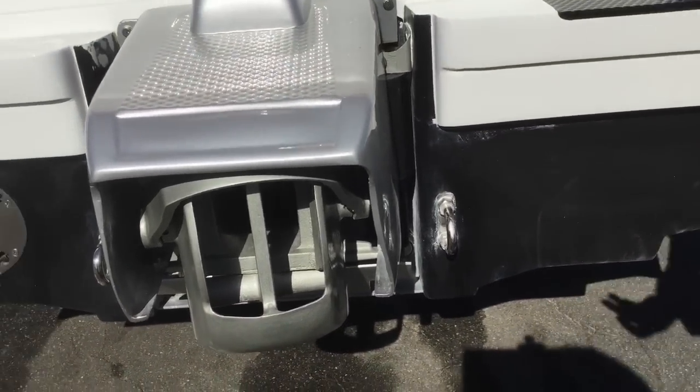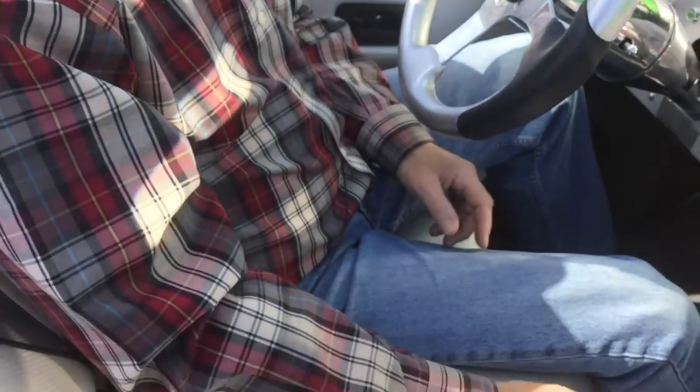So now let's get in the water car. Welcome aboard. We're about to take the water car in the water and want to show you the steps you need to go through to safely operate it — drive it into the water as well as retrieve it. There are really three things you always have to remember: one, entering the water, you need to engage the jet; you need to shift the transmission into neutral; and you need to raise the wheels. We kind of reverse that whole process when we come back out. The first thing, and the most challenging, is to engage the jet.